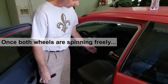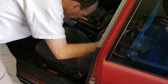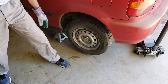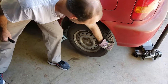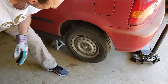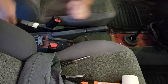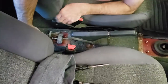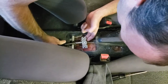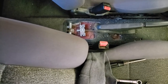Next, lift the parking brake lever until it clicks one notch. Now get the rear wheels spinning — we're gonna adjust the nut inside until we hear the brake just lightly touching. While it's still up one click, you're going to adjust this nut back here: it's a 12 millimeter nut, clockwise a little bit at a time, until those back wheels just start getting some friction from the brakes.